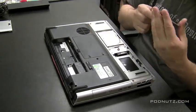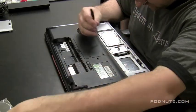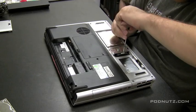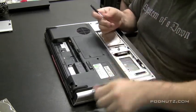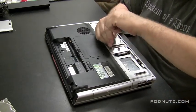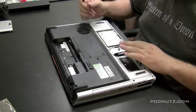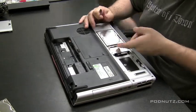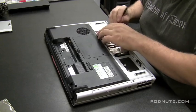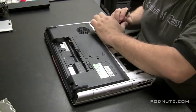I'm looking at the hard drive there, just checking if any corrosion is on the hard drive circuit board itself. And I tell the customer too — look, I don't recommend turning this on. It may or may not work, but if you want to save the computer, let me take it apart and inspect the motherboard, make sure the motherboard's clean, there's no liquid still in there, and then we'll turn it on. They understand that, and they're willing to pay for the diagnostic, even if the computer's fried. At least I'm giving it my best shot.